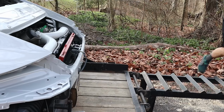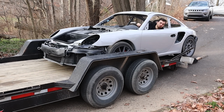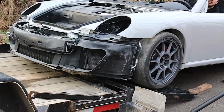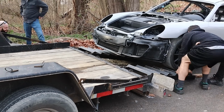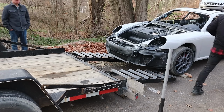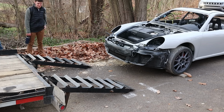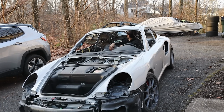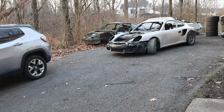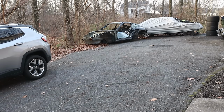When loading and unloading the trailer, the only way to get the car to move was to crack the front bleeder screws loose. That's how locked up these brakes were. And I think the rear were a little locked up as well, but we'll go over that a little further and confirm it in the next video. I'm pretty certain this is why the axle snapped, because the axle was trying to turn, but the wheel wouldn't let it because it was locked up, so something had to give, and it just happened to be the axle, the front left axle. The only way the car is moving right now in this clip is because those bleeder screws are uncapped and loosened, therefore I had no brakes.